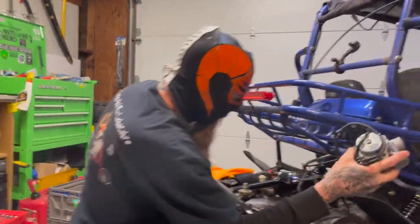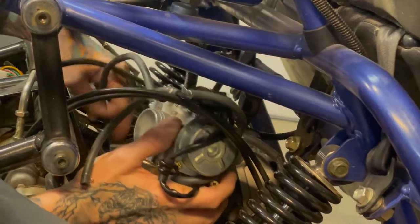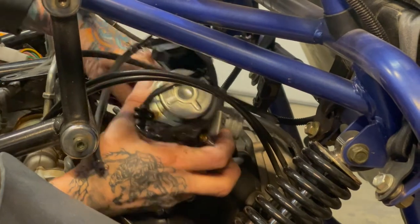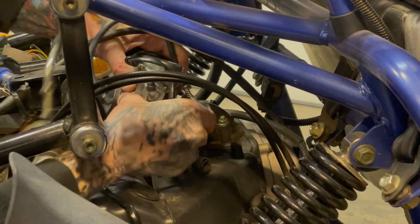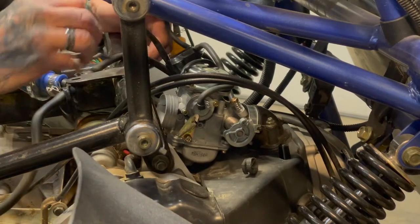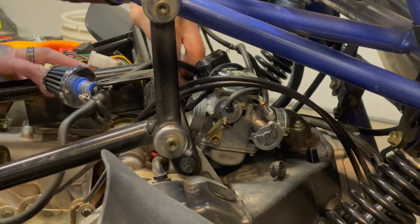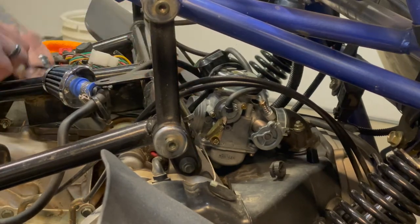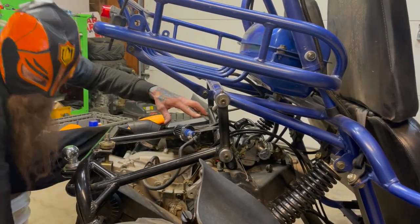All right, people. We're going to put this back on now. So, we stick this back in the hole and run your vent tube down below. And then stick your carbidoodle back in its proper place. Okay, now, as you remember, we have the electric choke that we need to run back down inside our little black box. So we'll run that accordingly, keeping all electrical components safe inside said box. Right, now we can put our little black box back on.